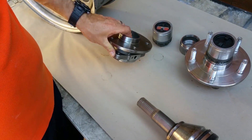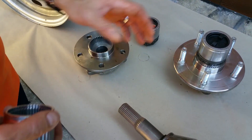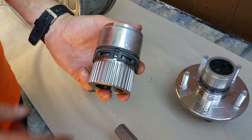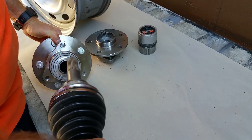All we did — looky here, pretty cool — we got a factory Timken hub for a Dodge 1500, machined that spline for a plug, and voila: factory Dana 44 locking mechanism. You end up with a beautiful setup just like this.